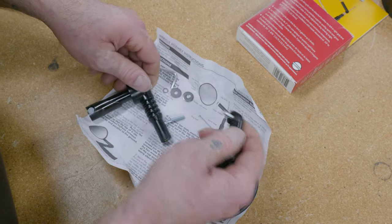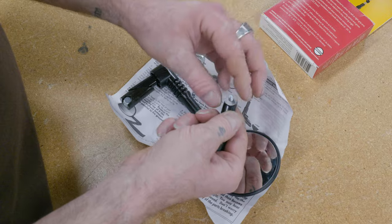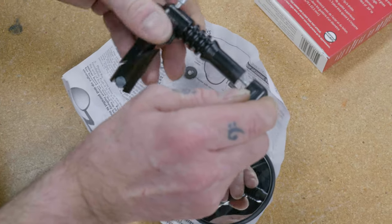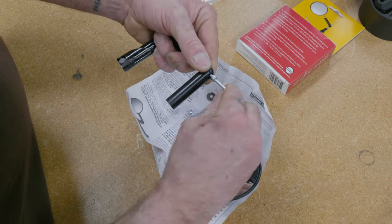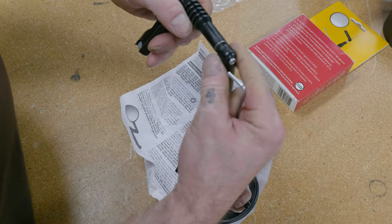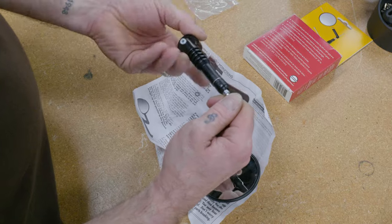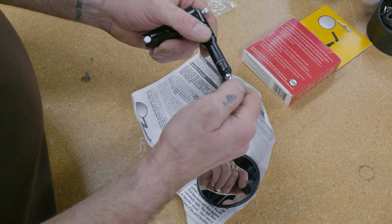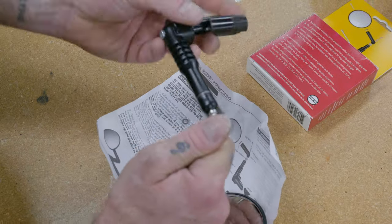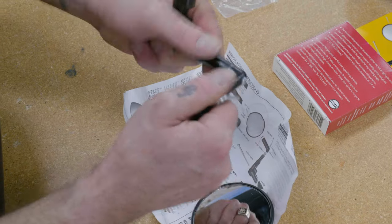And now, before I put it against here, to help when you're turning it to adjust it, we're going to put a bigger washer that's going to help with the friction. So from there, we're just going to go like this. Same thing, put a few threads in, and after, grab the tool they gave me and keep tightening it down. It's going to feel like it's tightening a lot when there's still play, but that's normal, so don't be worried about breaking something. Just keep turning until you're about a little bit more. You want to keep it kind of loose for the adjustment, but you don't want too much play. There we go. So I can move it, there's no play, and I'm not forcing.